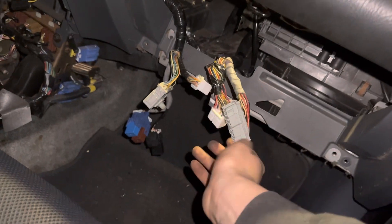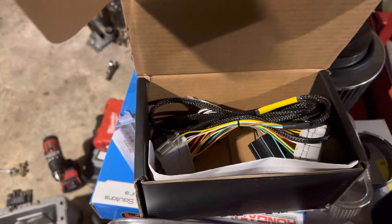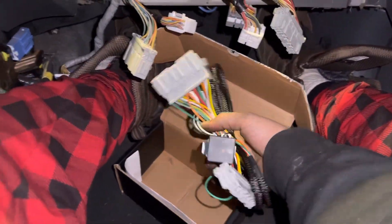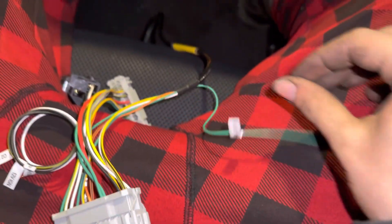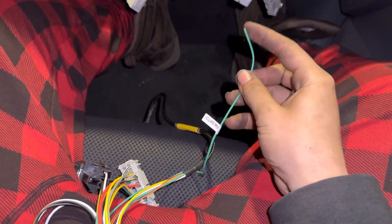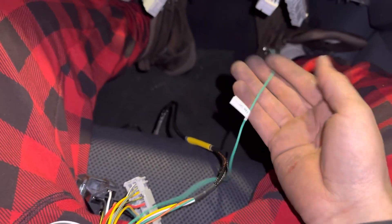Interior is what I've got to do now - just hook up the ECU and the harness adapter. Finally whipping these out. This is the new swap harness - looks pretty damn cool. This fan switch we won't be using because we already hooked it up from the fuse box to the sensor directly. If you want, you could hook it up to this, but from what I heard you don't have to use it, so we can skip this.